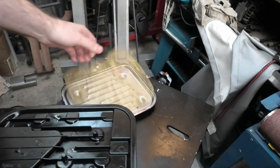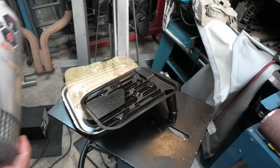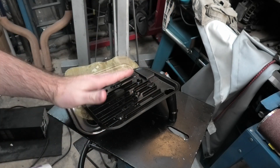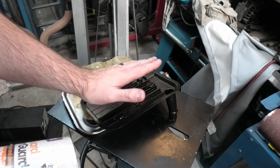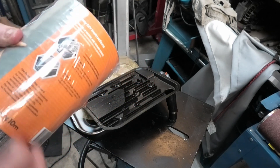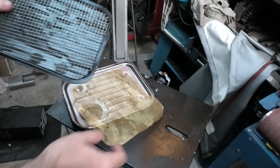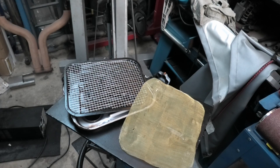What I propose would be done with this — and I'm not going to reuse it, just demonstrating — is to use something like this relatively rigid steel mesh, and build a little ledge for the brass filter material to sit on top of, so it can never really suck down to that pickup location. I'll just cut a piece off and make what I'm talking about so you can see the point I'm making. That took me about five minutes. That's my idea — it's not the only idea, but it's a way to make this filter work without the risks.